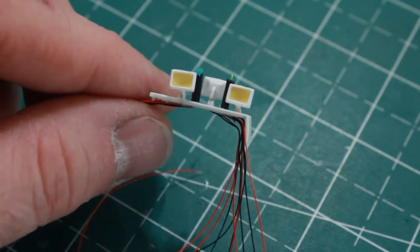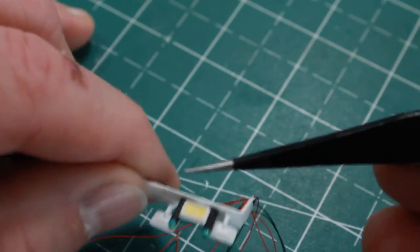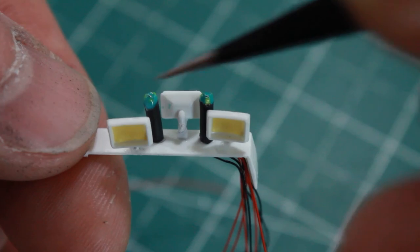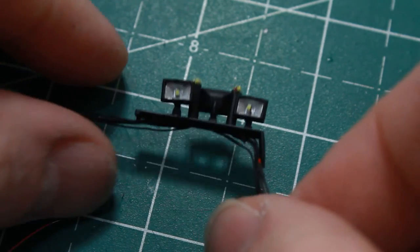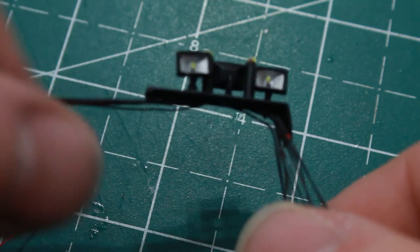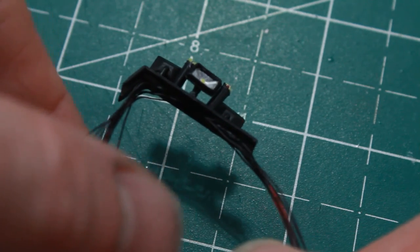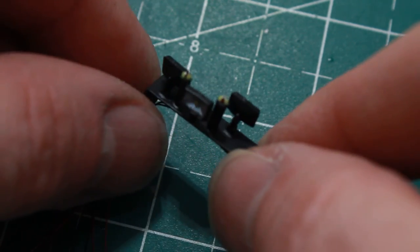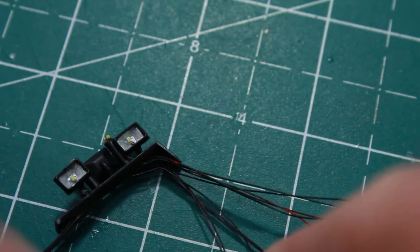Now that I've marked them, I put tape covering the LEDs in the panels, a piece of tape covering the rear LED, and used liquid latex to cover the chasers so I can paint the entire light bar. I sprayed the whole light bar black, then filled in silver on the inside of the panels for reflection. I also painted the rear panel with silver paint inside as well. I'm leaving the wires black — they'll be exposed a little bit, but it's all looking really good so far.